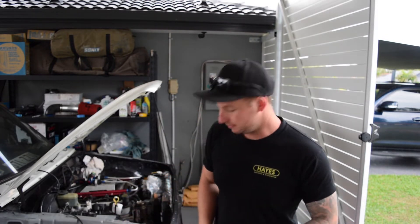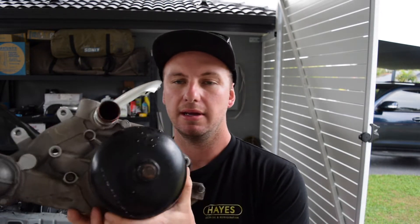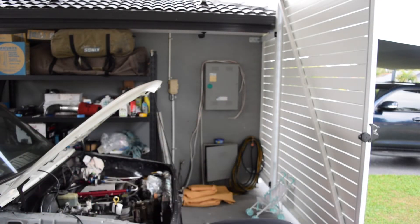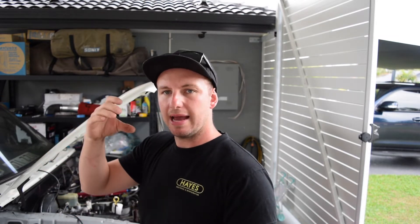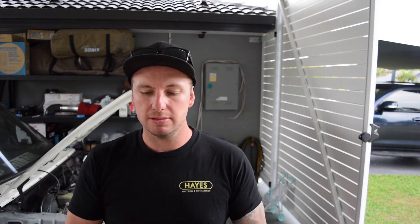Next up: radiator clearances. This is the LS1 water pump — that pulley is just ginormous. It was fouling on the front and I couldn't even fit a radiator in. What we did was swap to an LS2 pump, which gives you 40 mil more clearance, which is what I needed for the radiator with the engine that far forward. You need to line the pulley up with your existing belt track — one method is welding a nut onto the pulley and bolting into it to pull it out. Another way is using spacers — like the Marks Forward Drive adapters — which space it out 19 mil and line it up.